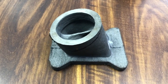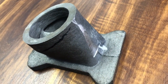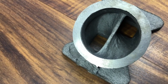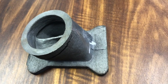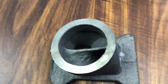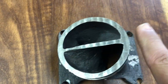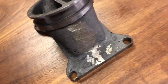This is the first revision of the swirl adapter. Remember, this casting is not a final product — it was made from a 3D print specifically for various checks: dimensional, angle, and so on. We then made a couple of changes. The most noticeable one is where the outlet on version number two comes up flush with the mounting face, which is obviously V-band.